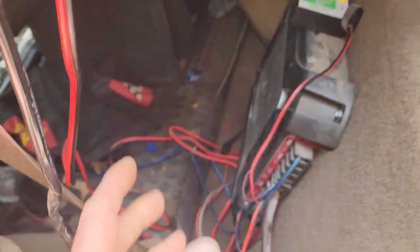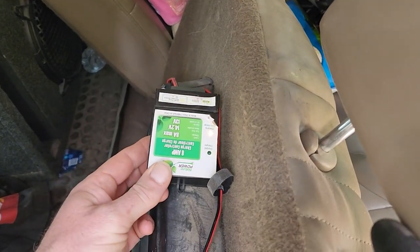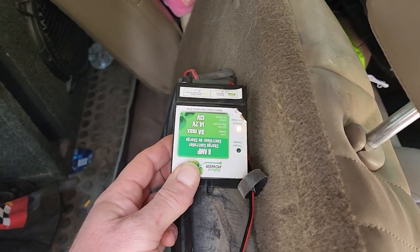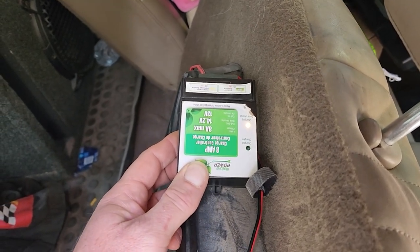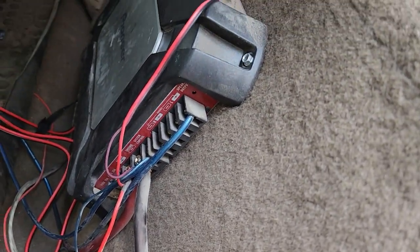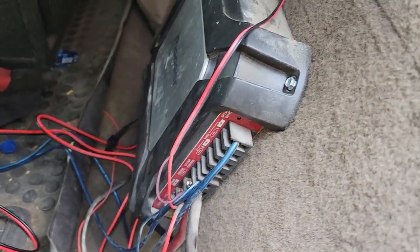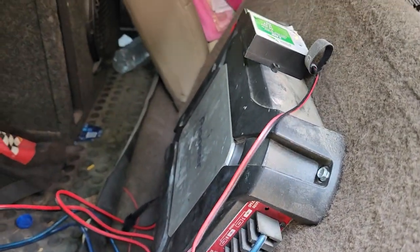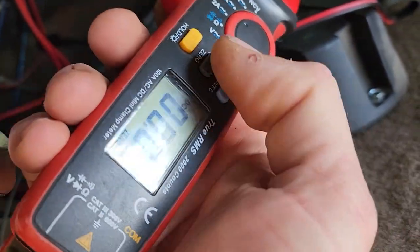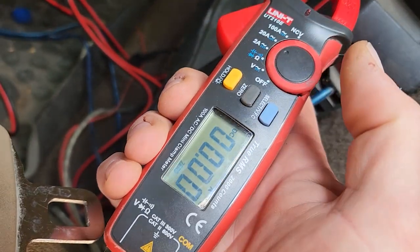This is just a really quick and dirty solution so I don't have to go buy another $100 battery. That wire goes into this little tiny 8-amp solar charge controller. It's real lightweight, real flimsy — I've had it for about seven years. It's a Nature Power controller that went to a solar panel that no longer works. That charge controller connects to the positive and negative power supply wires for my amplifier to the stereo, because those wires run through the firewall to the battery directly and they already have a fuse installed, so I was able to cheat some of that work. But you could run yours straight to the battery — you're just going to need to use a fuse, and I'll go over that more in a second.